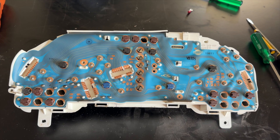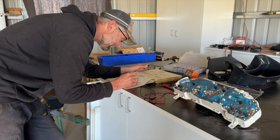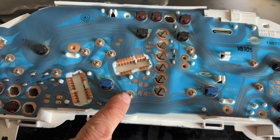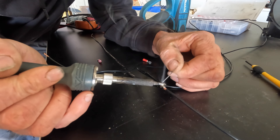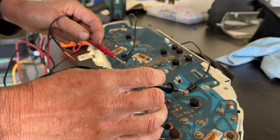There's lots going on with this instrument cluster. I've been testing the continuity between all the earthing, tested the continuity in the cab between all the plugs, and looked at all the wiring diagrams. Nothing jumps out at me, but the one common denominator is earth — the same earth point is in every single gauge. I think where it plugs into the back of the cluster only touches on a little tiny ribbon, and we normally lose it in heat or vibrations. So the plan is to run a hard earth wire from the cab straight up to the back of the instrument cluster onto the circuit ribbon. I'm also relocating the light switch which was causing wear on the rubber seal — I'll double-sided tape it inside the canopy wall so it won't ruin the seal.